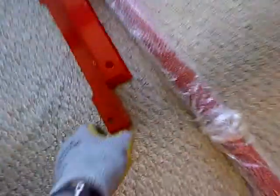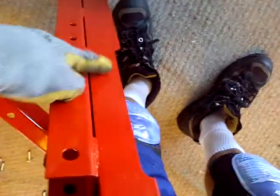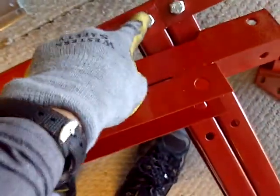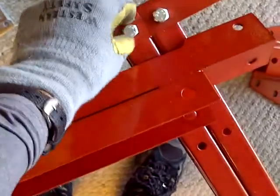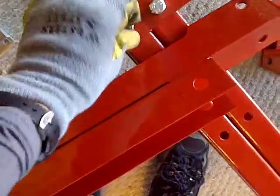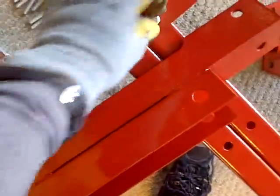So I had to flip this whole thing upside down because it's a little easier to work upside down since you're going to be working on the axle and the springs. That's one of the phase 5 parts here — basically this part right here, this weird-looking thing. You got to match it up to this slit right here. And what you got to do is, since we're on the bottom, you got to remove the bolts.